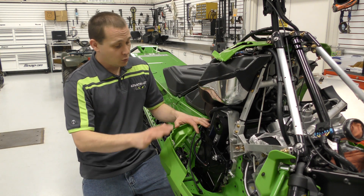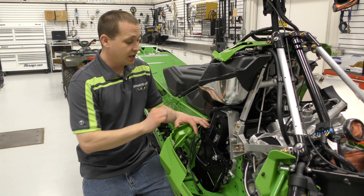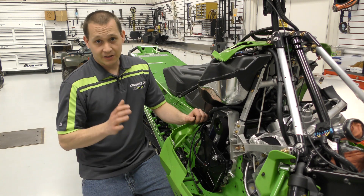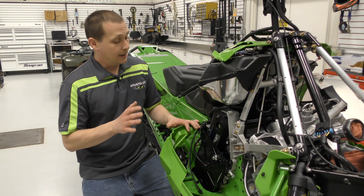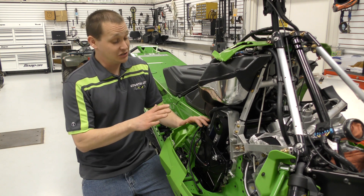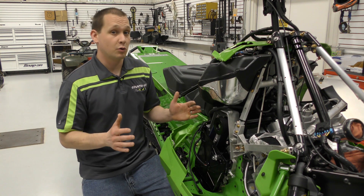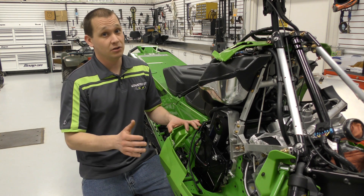chain — throwing them off to the side. We're putting aluminum gears on here and running a belt drive system to transfer power. This is going to save a lot of weight overall, but most importantly it's rotational weight, which is crucial for making these things spool up fast — acceleration. It should be a really killer setup. We're excited that this is the same type of system that a lot of the pro mountain drivers use on their sled, such as Rob Kincaid and Dave McClure.